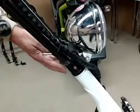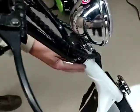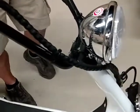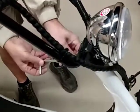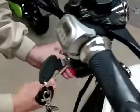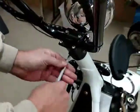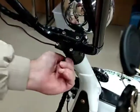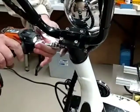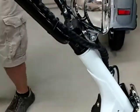If it's still wobbly, then it's not from the handlebars not being attached — it's the steering stem, which I'm going to address now. If it still has a wobble to it, what you need to do is totally remove those bolts that I just tightened. Then you're going to lift up on the whole steering handlebar assembly and it will come right off the stem.